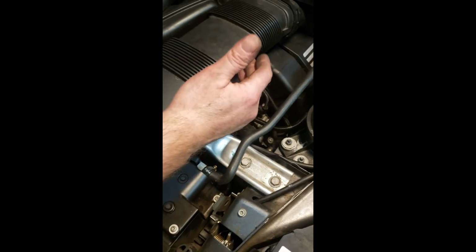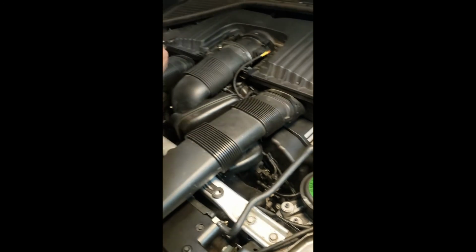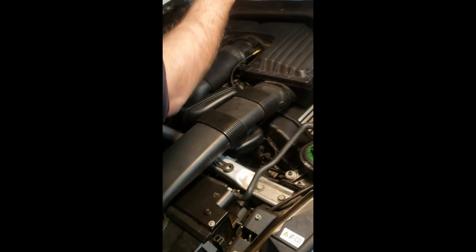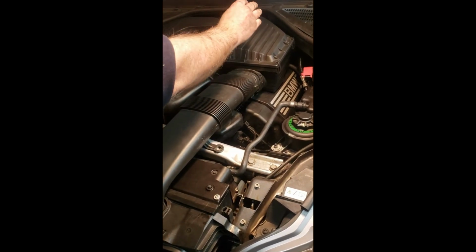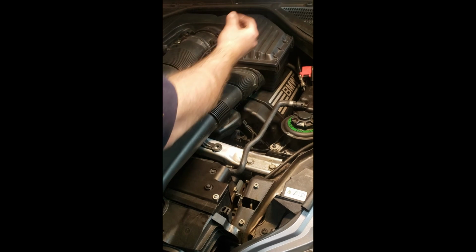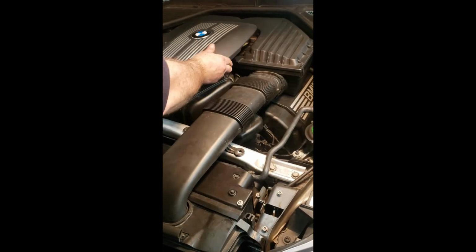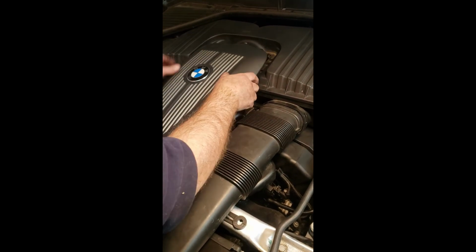Oops. If you're going this far, you want to make sure that maybe possibly you want to do the front chain covers as well because they leak. Keynote, you want to make sure that you're putting the silicone or the RTV blue or whatever on the back on the half moons where the camshafts are, and those corners are susceptible to leak. So with that said, we're going to put the final cover on. We're going to button this one up for the day.